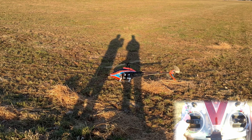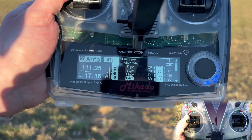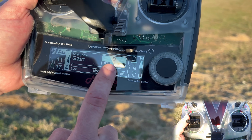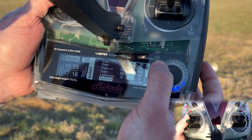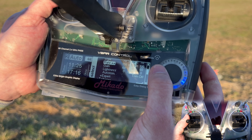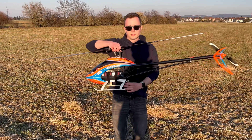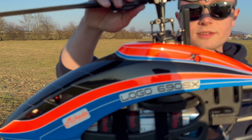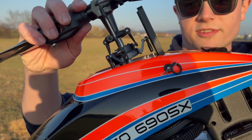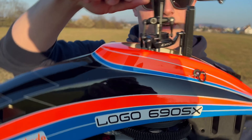And we are down. We're gonna prove that we are still at zero gain — can you get this in focus? Thank you. Gain zero. We flew at this head speed of 1,400 RPM. Rate 130. And just take a look at the swash when I tilt it — no compensation happening. If we switch it down to the 1,000 RPM bank, there's the compensation again. Hope this video was educational. Hope you learned something. Thanks for watching.